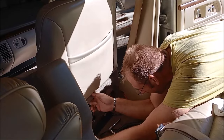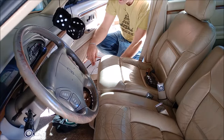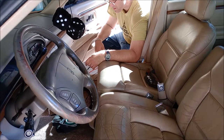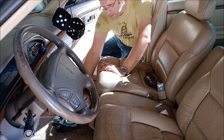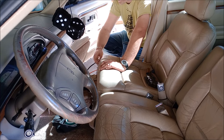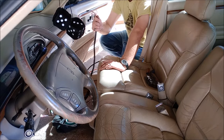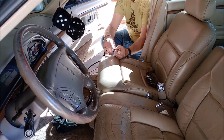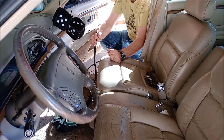I put my bus bar from one side to the other and I've got some grounds and a power wire. I have two switches there underneath the dash that I need to pull out. There's one more bus bar in the engine bay, but since what I really want to save is this coax cable and this power connector for my radio and antenna tuner, I might use my side cutters and do some cutting here.